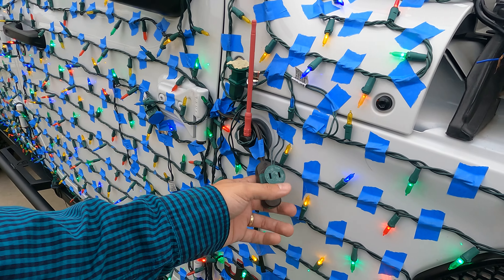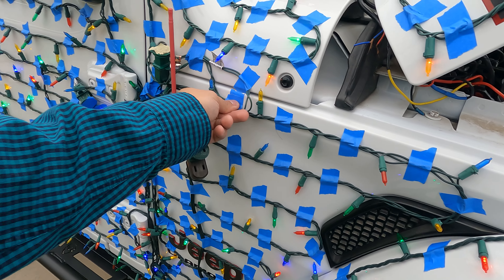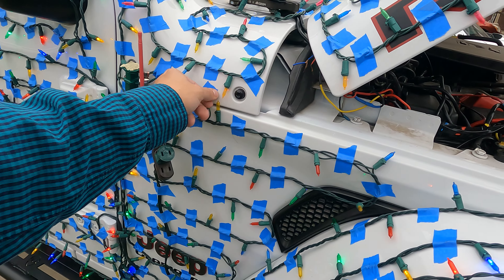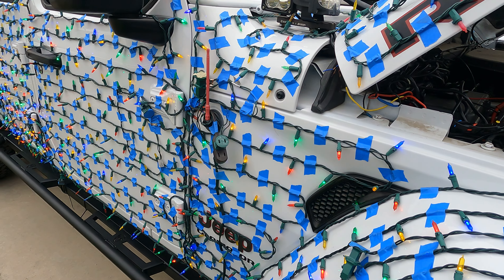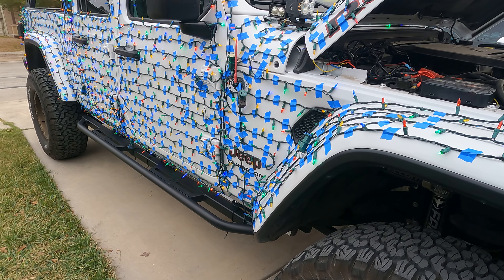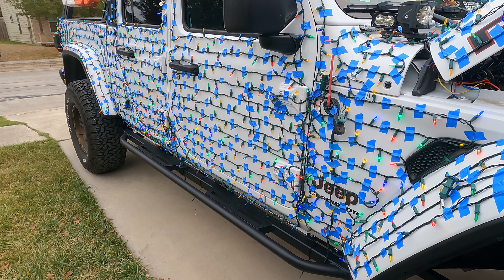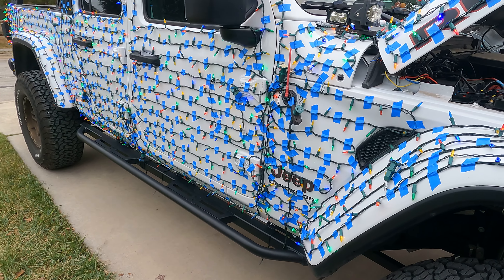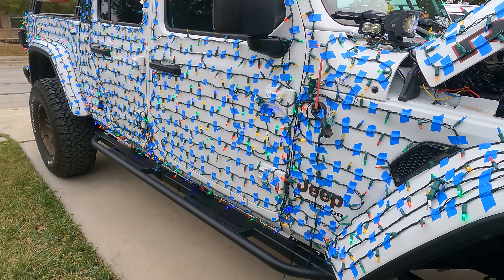From there, I just go ahead and start putting my lights, and I use painters tape to adhere the lights to the body. It's simple Scotch Blue painters tape — I get it at Walmart or Home Depot, but you can go online and get color-matched tape to match the color of your Jeep if you're trying to camouflage the tape. Just don't use masking tape. I did that mistake one year and it was really tough to clean. A month later after you take off the tape, you'll see all the residue that you will have to buff out by hand slowly but surely to prevent damage to the paint.